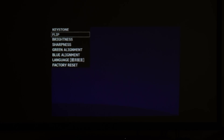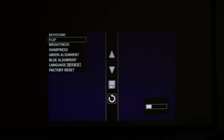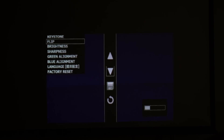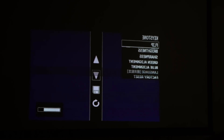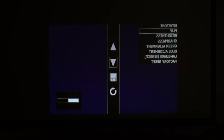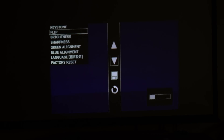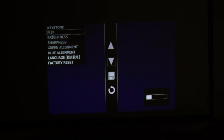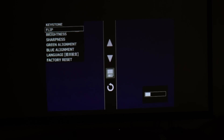I'm going to run through a few of the other settings available. We've been through keystone already so I'm going to go through the flip now. There are four different settings for flip — as you can see some of them are upside down and others are mirrored. The reason this is useful is if, for example, you're mounting it upside down such as on a ceiling mount, you can then have the picture still the correct way around. The mirrored settings are for use where the projection is coming from behind the projector screen rather than in front. You can save whatever setting you have by scrolling down to save and clicking it.